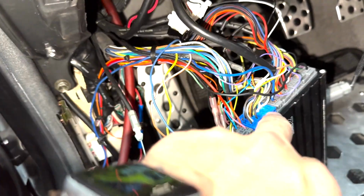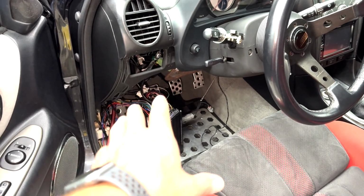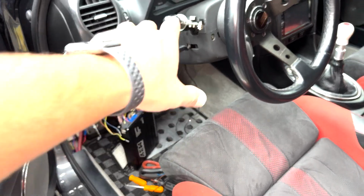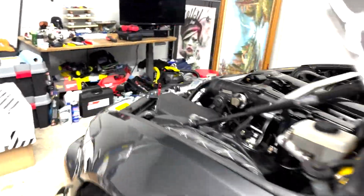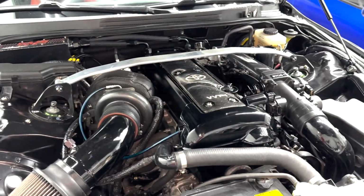So I'll explain along the way what those are. And I'm gonna go ahead and wire those to the chassis and take this fuel pressure sensor and run it into the ECU. And what that ECU is doing is, this is the CAN signal and the CAN wire right here, which is connected to the screen, and the screen displays all of our engine diagnostics. So the CAN system on the ECU translates all of the engine parameters through code into the screen there. The BTI screen that Brandon makes. Amazing stuff. I'm really, really loving it all the time. But yeah, that's what I'm running through here.